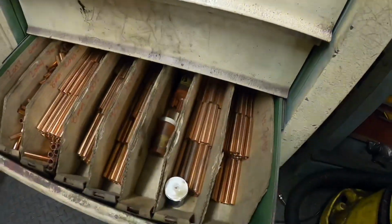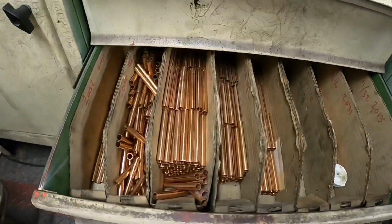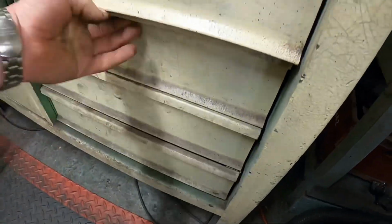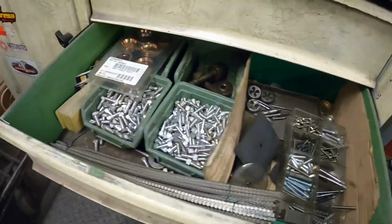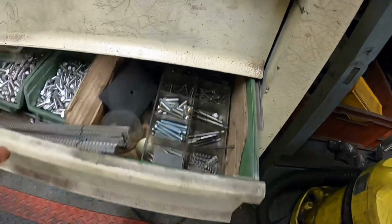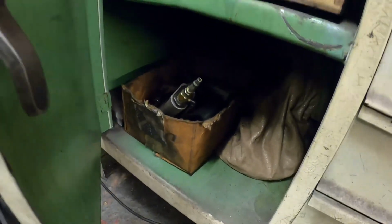And this drawer here is all the tooling to do bronze thin wall guides. If it's a quick repair on a worn guide, we can sort that, most sizes. That's some of my stitching kit, so if we need to repair any aluminium or cast, I can do that with that kit there. In there is more of the stitching kit and also more of the guide kit.